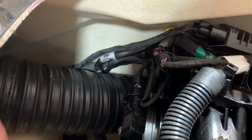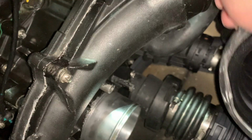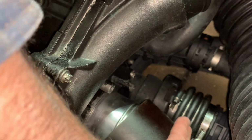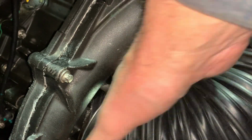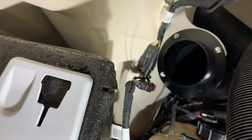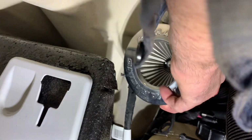I installed the hose from the front to the back, and then I slid the corrugated hose air inlet underneath of the intake manifold. I already had my supercharger inlet piping off. This is the velocity stack. This helps guide the air into the eye of the impeller, and it adapts to the larger airline. As I mentioned, it would be easier to put the filter and the hose on before bolting this in. In my case, I had to put all the clamps on inside the front compartment.